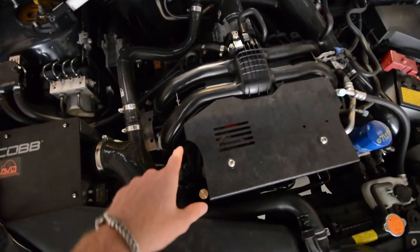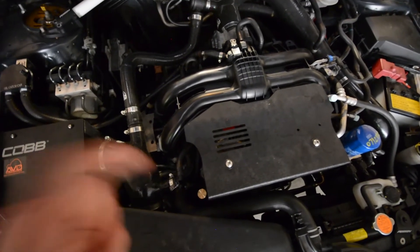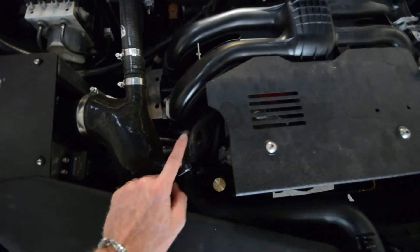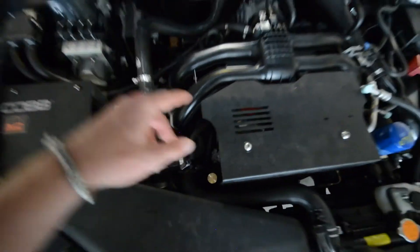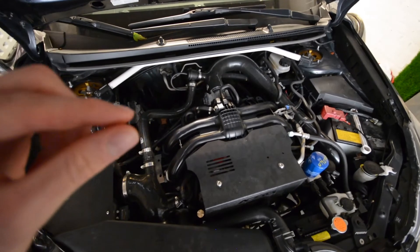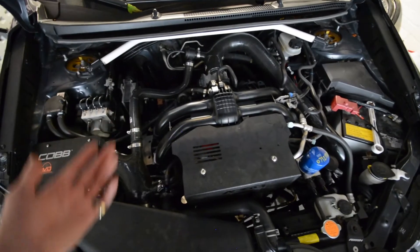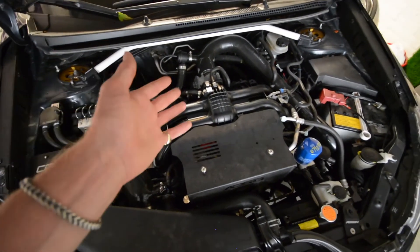The car does have 08-14 WRX dark blue 565cc injectors. It's got the TGVs deleted, and there is a divider underneath the TGV on the top of the block — those have all been removed from the four locations. I do have an IAG EGR delete on the car as well. There are two little standoffs on one of the block-off plates that had to be shaved down, but any other EGR delete for an FA20 will fit these cars without modification.